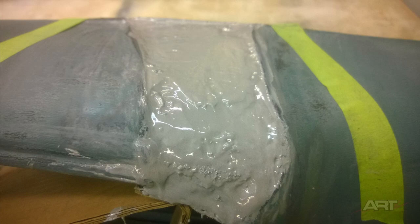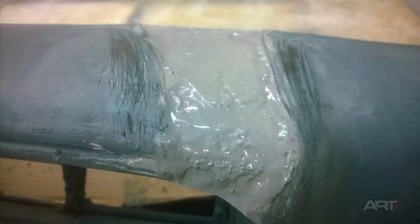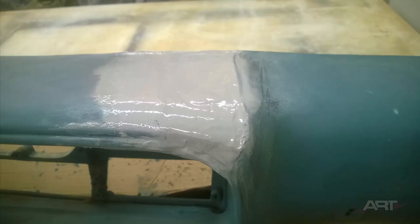For the first application, I'm happy just to bring it up to level. If you've ever had epoxy peeling on you while you're trying to sand it, you know the importance of really, really rough sanding the plastic at this point — even gouging it with a saw blade if you need to — to get a rough surface for proper adhesion of the epoxy.